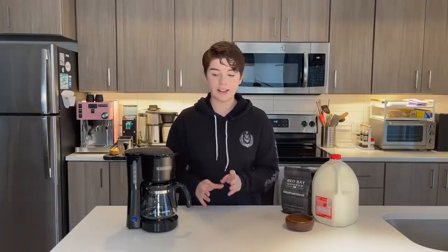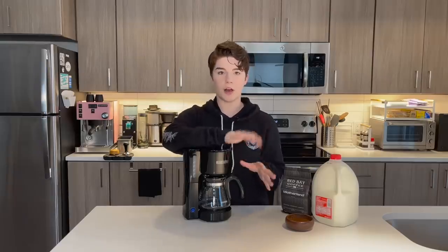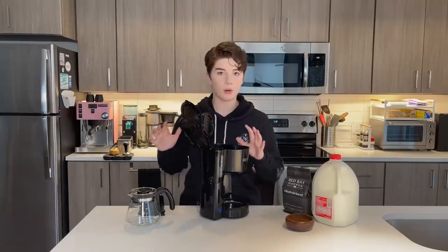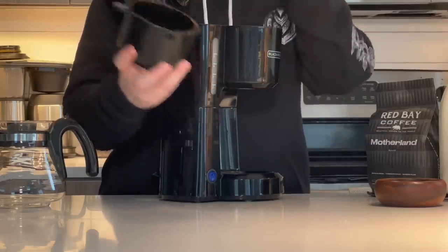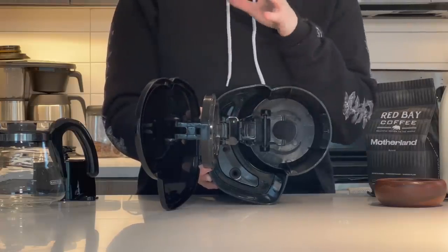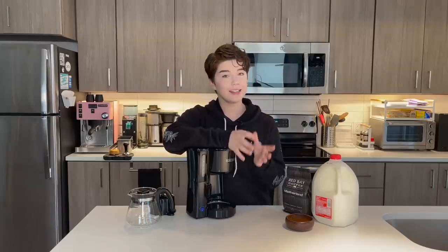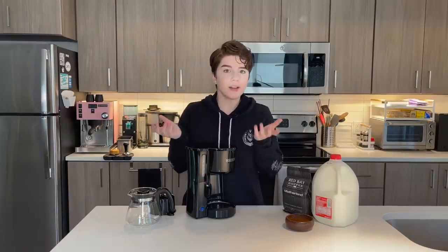There's an even more important component to why one should not do this, and that is the make of these machines. Most drip coffee makers, most Keurigs, even most espresso machines all have the same general build. You have the basket where you'll place your filter and coffee, and then you have the water chamber. Inside the chamber, you have some sort of piping or tubing that draws your liquid up to the brew head, which then disperses hot water evenly over your bed of coffee. Ideally, you'll descale it or run cleaning cycles pretty frequently because there can be mineral buildup in those pipes. That's pretty easy to manage if you're just using water.